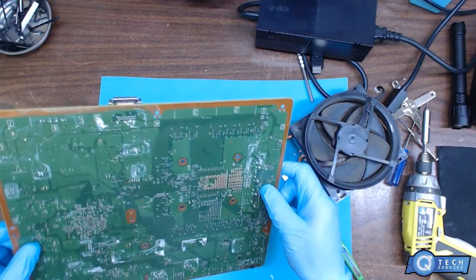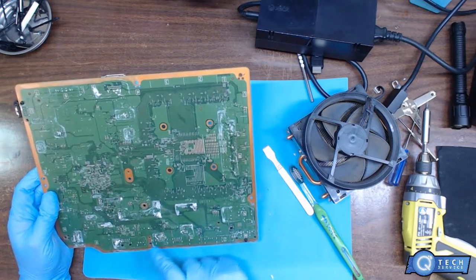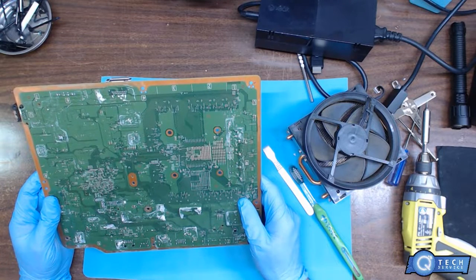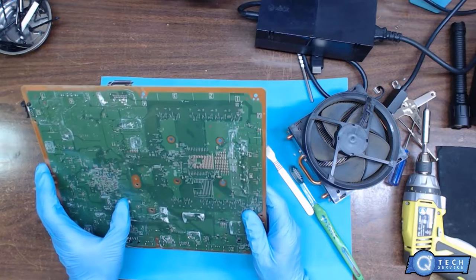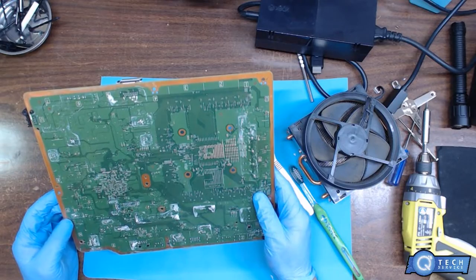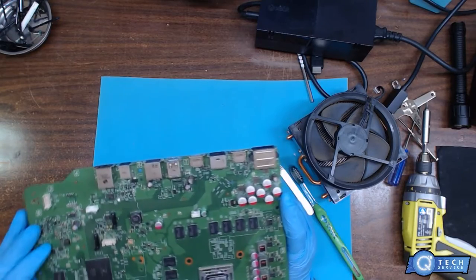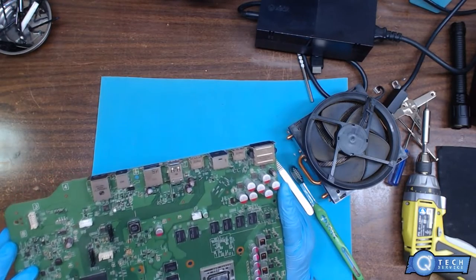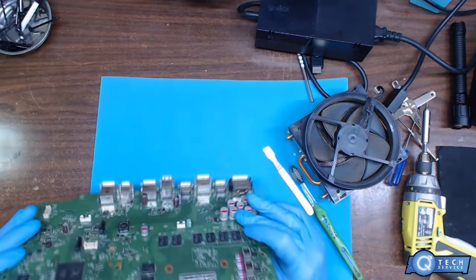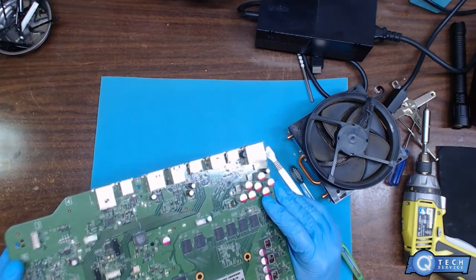I don't know what some of this stuff is. That's the resin they use from the factory. I know you would see a little bit on some of the back connectors, but not this crazy. I can't say I haven't seen it, but not splattered all over, in all different spots, which is just kind of strange. You would probably see some of that with capacitors leaking, but there's no way for the capacitors to be leaking on this side. That's what they would have used to solder the capacitors and connectors in, which is flux. But I mean,